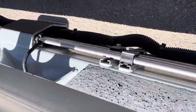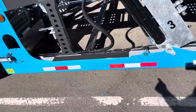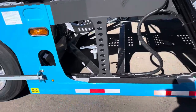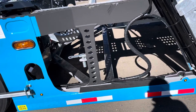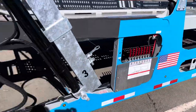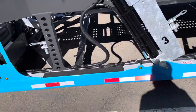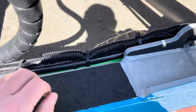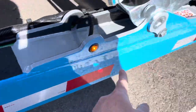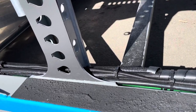Down here you also have your electric lines routed outside. When you route electric lines inside the posts, eventually they chafe — especially if the post rusts, you get sharp edges that wear through the rubber housing of your electric hose, eventually creating a ground. You'll have issues with your lights and won't know where it's at — you'd have to chase it through the entire length of the frame rail. No longer. Lore has everything outside: hydraulic lines, airlines — nicely tacked, zip tied, not moving. That's a major improvement.